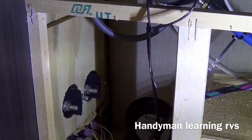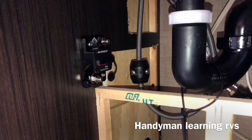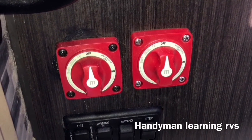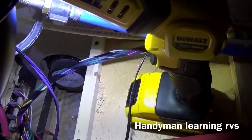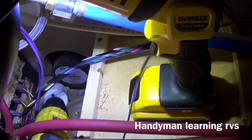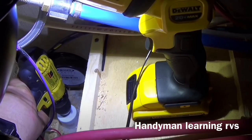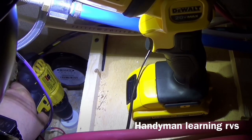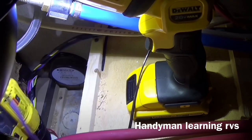I took a half-inch piece of plywood and put it on the back of the cabinet, then drill two-inch holes for the switches to fit. And I install the 250-amp inverter circuit breaker. I drill a two-inch hole through the floor just so I can have an area for my wires to pass through to the original battery location, to attach to the chassis and to the original breaker. I use my two-inch drill to make the hole and then go underneath the vehicle to finish drilling.